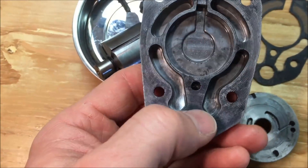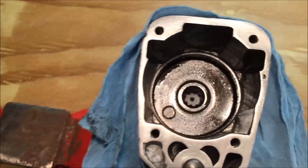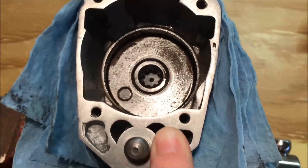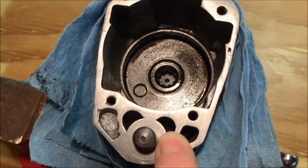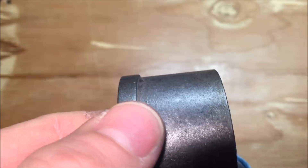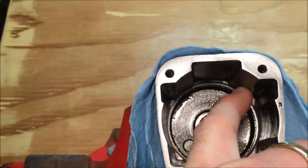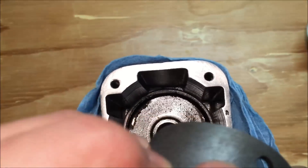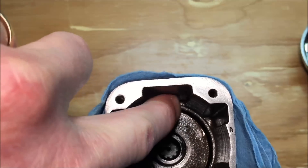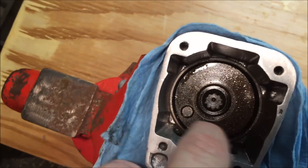These are pretty good channels, so I don't know that there's a lot that I would do to this. Maybe if I end up drilling these holes out here a little bit, maybe I'll match them up to this. There's this slight gap here between this cylinder and the inside of the gun itself, and the air basically comes out of these holes, works its way around, and then it exits the two exhaust holes in the bottom there, one on each side.